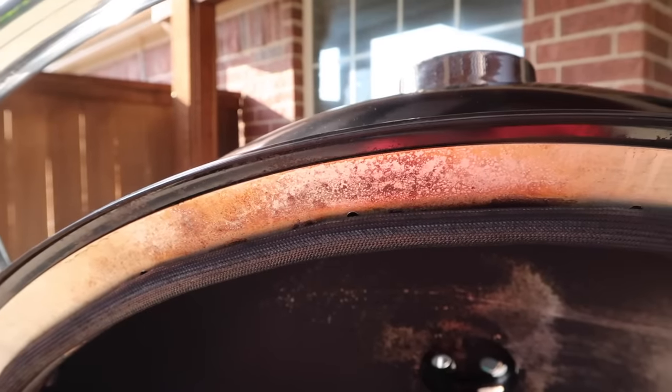What had happened is the gasket had dropped. The gasket is held to the dome with these two little things that kind of look like staples, and in between there's a little gap between the dome and the gasket itself — that's where the smoke is leaking out. It's not a problem with the gasket itself; it's just not sealing. If we just did a little line of some sort of adhesive it would hold it on there and fix it. But during all this, nobody actually looked at my specific situation closely. I feel like the engineers could have fixed this super easily just by engaging, but instead they were giving me solutions that didn't even make sense.